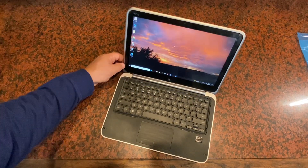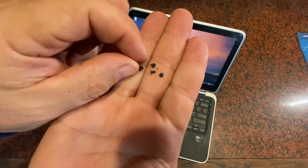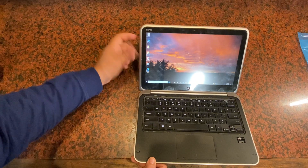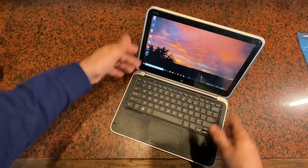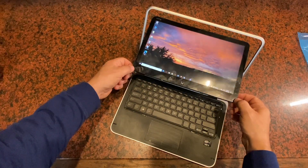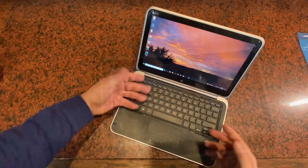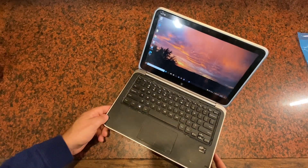One thing I noticed — I forgot to put some interior screws in. There are four of these somewhat larger screws, just a little bit thicker, and they are used on each side of the hinge. Those are going to go in before you do the outside screws, before you put the case on the back. I probably will skip them — I don't think they're that crucial, but those were needed on that little metal flange attached to the touchscreen. Also, when this screen comes shipped to you, there's actually a plastic coating to protect it — don't forget to peel that off. I hope this video was helpful to learn more about how to swap out your screen on your XPS 12, and I hope this information was useful to you.